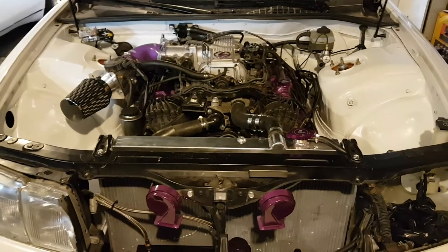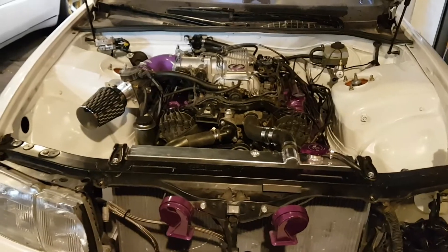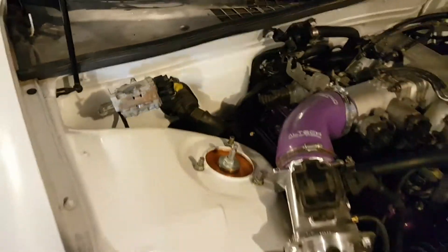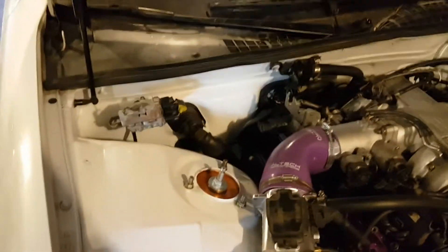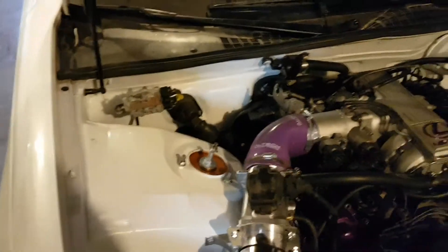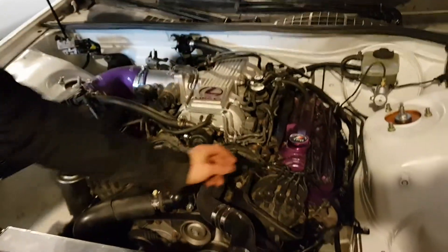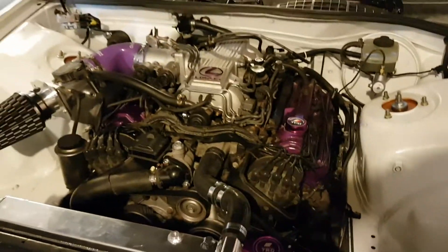That last clip was about a week ago and we've done a ton of troubleshooting since then. What happened was we were not getting any spark at all. The igniters need to be grounded, and we had moved them to the wheel well so they were a little more aesthetically pleasing, but we hadn't grounded them there. So for now we have them sitting back there looking ugly, but now we have spark. We also had some wires crossed — number four and six were switched, so one was sparking when it shouldn't and the other wasn't sparking when it should. It was really shaking badly.